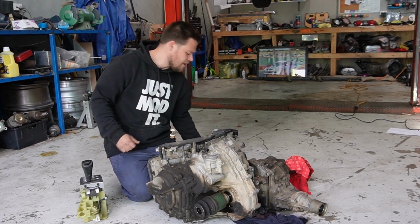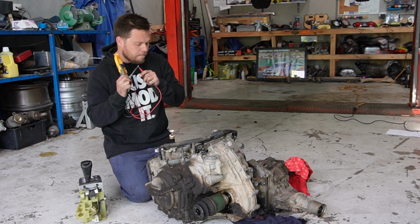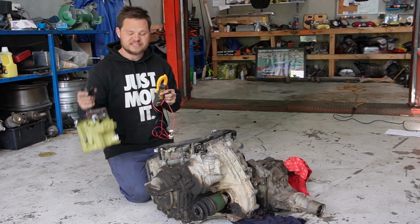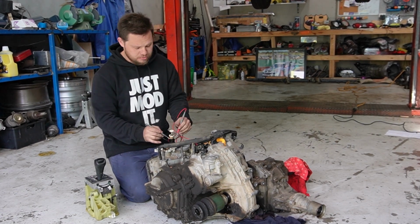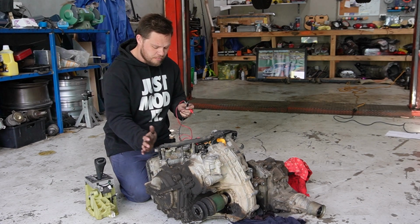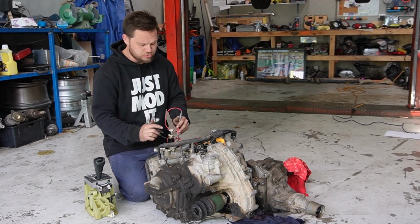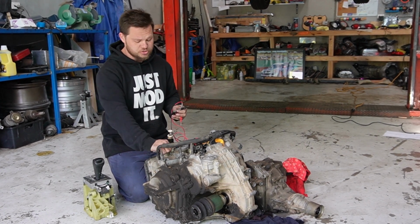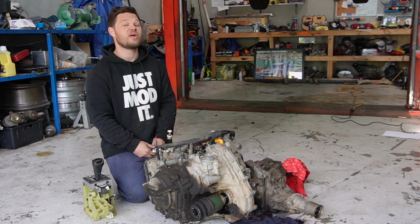So now all we've got to do, grab our multimeter set to resistance, go through, we'll probe every single wire until we hear that beep. That beep will mean that there's continuity between there. That'll link the switch. That means we can start the car. So we'll go through right now. We'll probe every single wire just on this one plug until we get it. So if we probe these two plugs here, that's continuity, that's a neutral start switch. If you want to check, bump it into reverse or any other kind of gear, check those two pins again. No beep. Put it in neutral, next bump down, so park, reverse, neutral, try again, beep again. That's how we know, that's our neutral switch. Now we're good to go and bridge that on the plug, and I think the car will fire up.